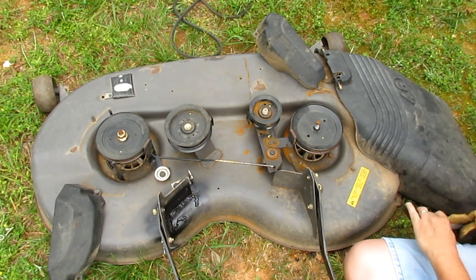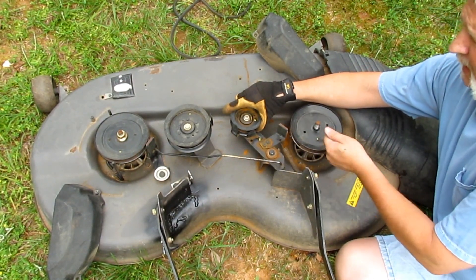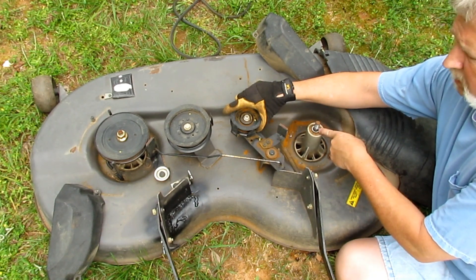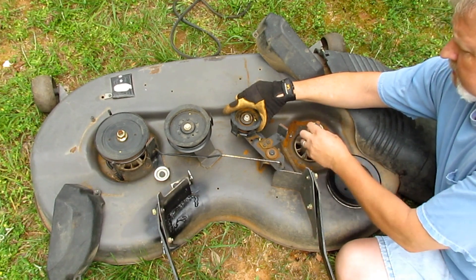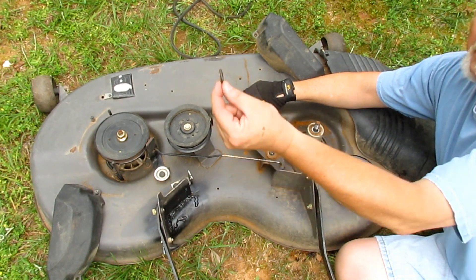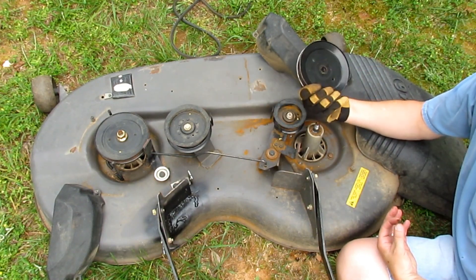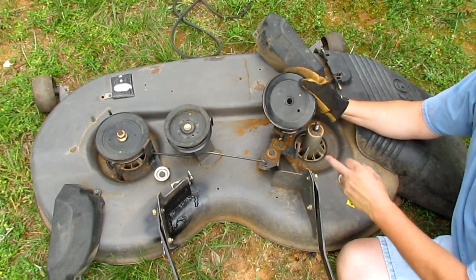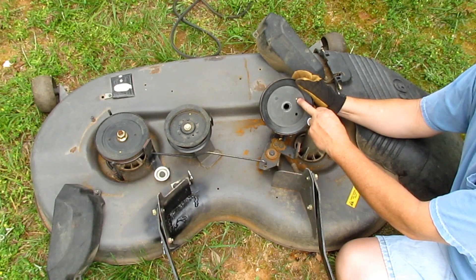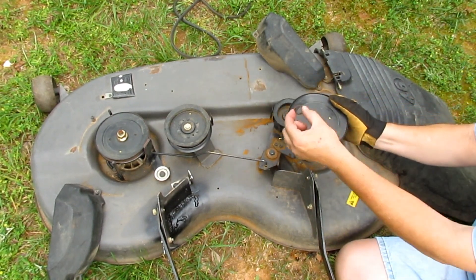That's easy enough. Sometimes these are going to be kind of tight, so you may have to take a rubber mallet or a dead blow hammer and knock it loose — it's on a little star shoulder there. There's a spacer washer — don't lose that. It's not a standard washer; it's a good bit thicker than a standard washer. The pulleys aren't marked top or bottom, and it probably doesn't matter. But if you're not sure, just mark it — take a Sharpie and write 'top' or something. Mine are marked with a yellow dot on one side, so I know that's the top, and I know the spacer goes underneath.